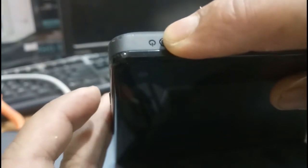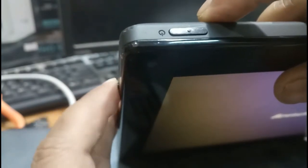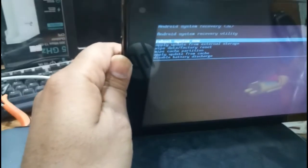Now we are going to power on this. When you power on, you will get a vibration. After getting a vibration, just press the volume up button two or three times. I'm going to hold the power button and the volume up button. Now I'm going to press like this continuously after the vibration, and you can see a message appeared on screen.